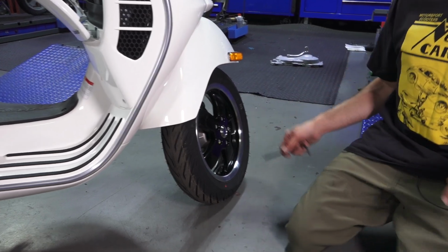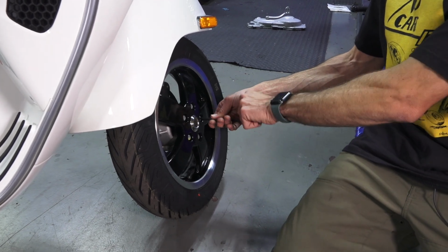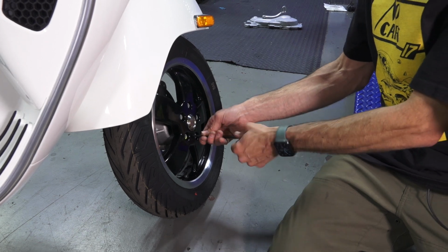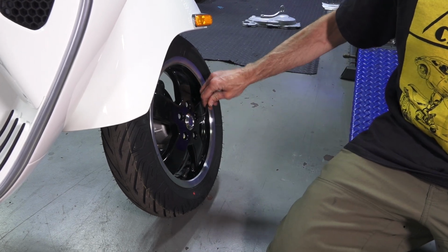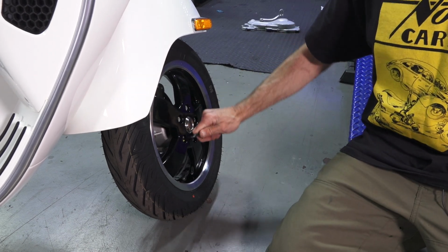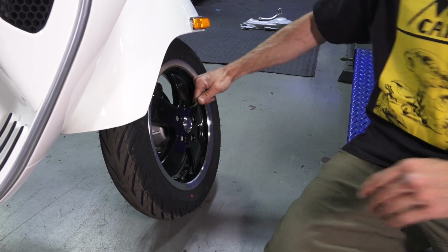And of course, when you get back to your workshop, it's very important to torque these to about 16 foot-pounds. And if you're on the side of the road, what is 16 foot-pounds? Well, it depends on how muscular you are. If you're a scrawny robot like me, I don't know. You can put that in there and just put your palm on it, give it a good little push, and do that on all your fasteners and kind of do it in a crisscross pattern.